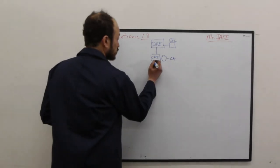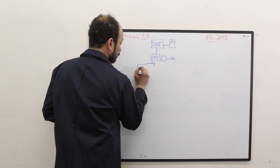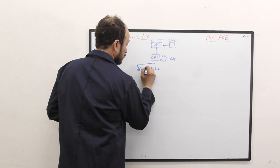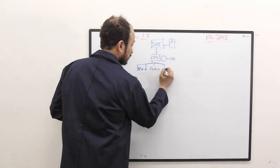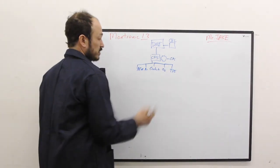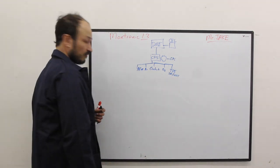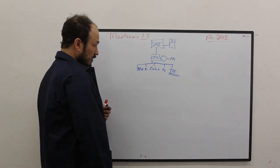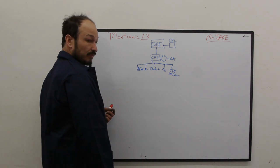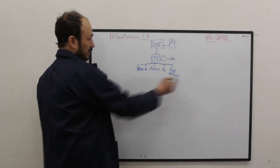So below our crank position sensor, we have a multitude of sensors. We have our AFM, our coolant sensor, an air temp sensor, our oxygen sensor, and our TPS. In this case, it's just a switch that tells idle and wide open throttle. I think that's kind of it. AFM. These are our electronics. This is what's going on.